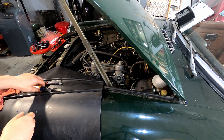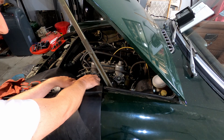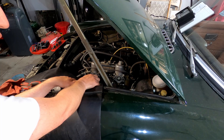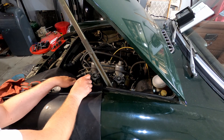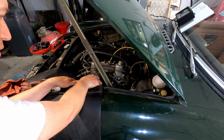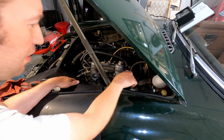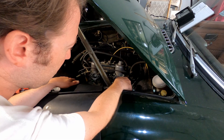The next thing you want to check is your mixture. You want to raise the piston a little — just over a millimeter is fine. Raise the air piston and what you're listening for is the difference in RPM. If it smooths out, then you know adding air makes it smoother — you're burning too rich. If you raise the piston and it makes the engine die off, now you know that more air is bad, so it's already too lean. That one might be a tad too rich; this one seems about right.